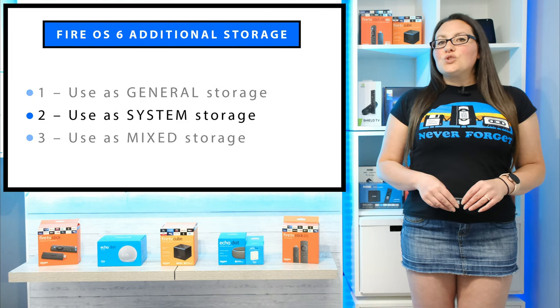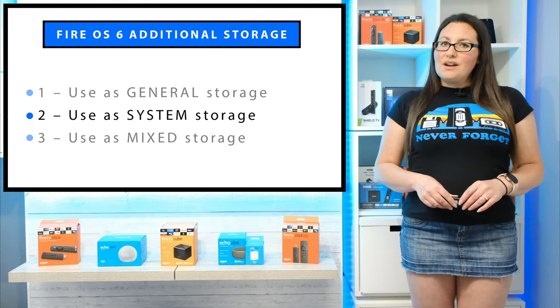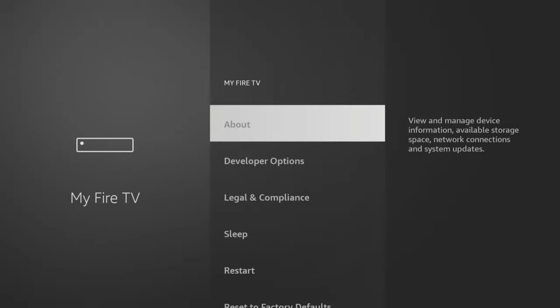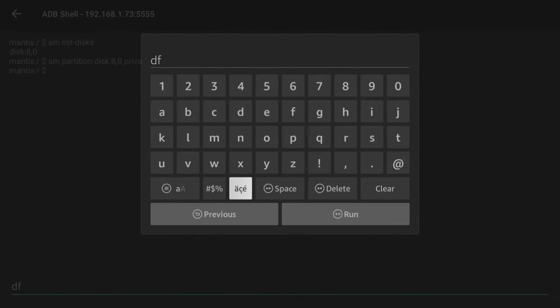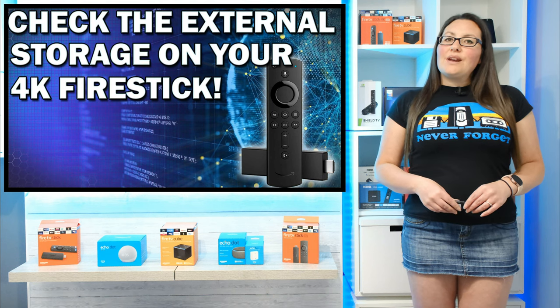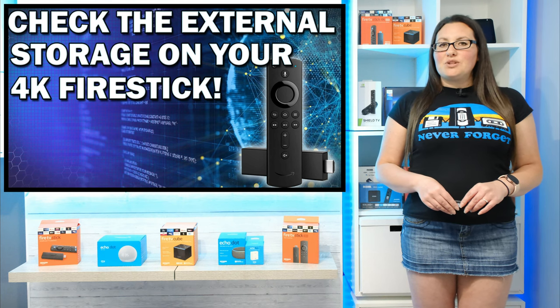If you are using your storage as system storage to install more apps and have successfully run the command in ADB shell, this means that your storage is now allocated privately to the system and you will not be able to see it anywhere. You won't be able to see it in the Fire TV About menu, and you won't be able to see it in Explore either. But you can check how much storage space is being used and how much is remaining by running a short ADB command. For full details on how to do this, you can follow my step-by-step tutorial showing in the link above me or in the description down below.